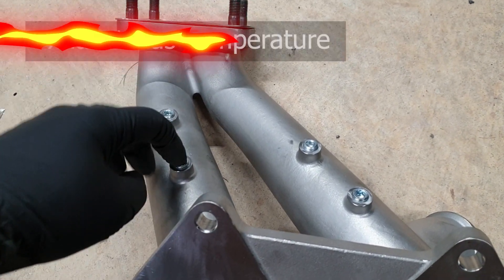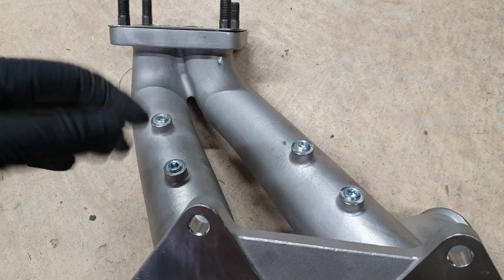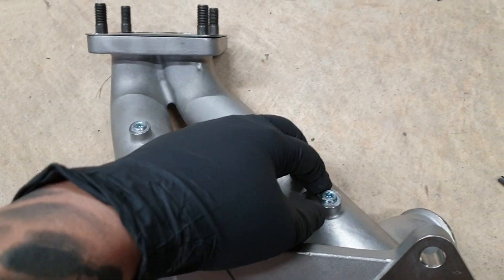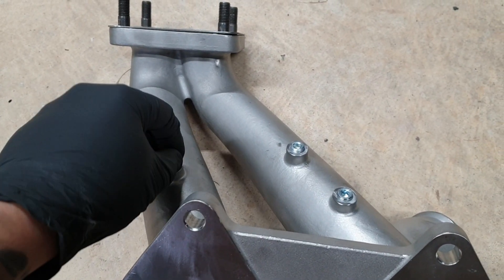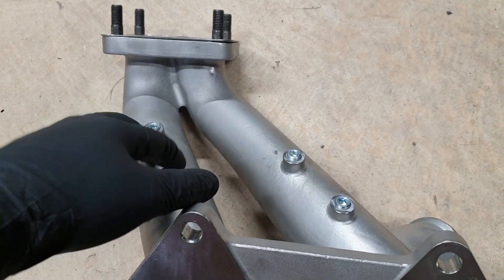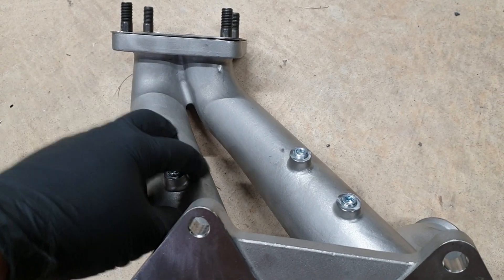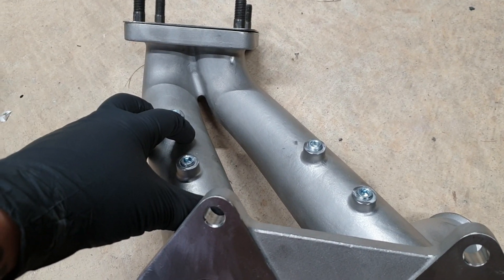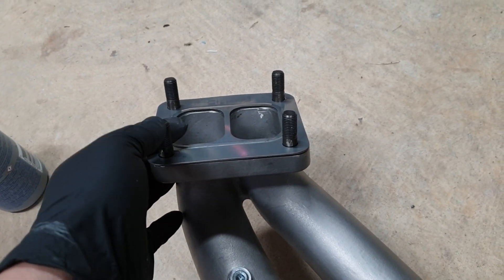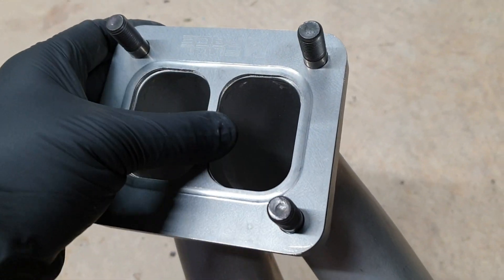The only downside of this is you need two wastegates and they're pricey. A lot of RX-7s are putting good horsepower numbers with this manifold. EGT stands for exhaust gas temperature — with this you can get more data every time you're tuning the car on each specific rotor. Most of the time they act a little bit different, especially in high-horsepower cars, and that way you can tune them individually to make more power but more reliably. The Toublon manifold came with EGT bungs, but I had to buy the full-race gasket separately.